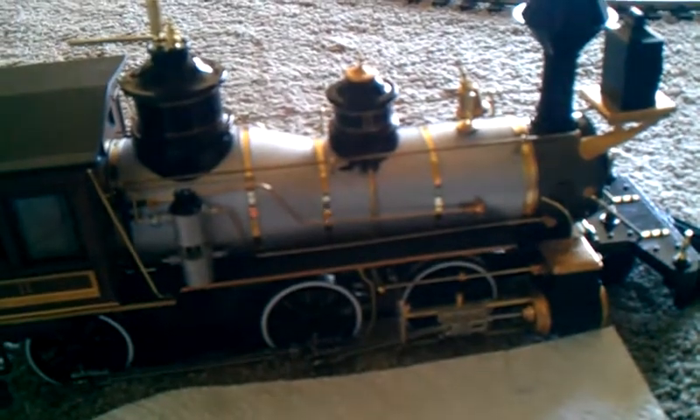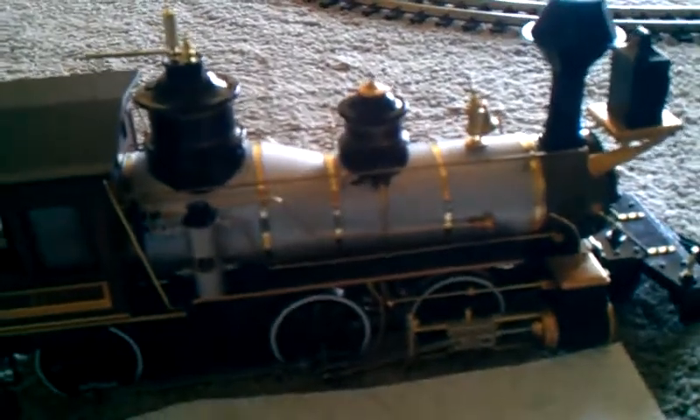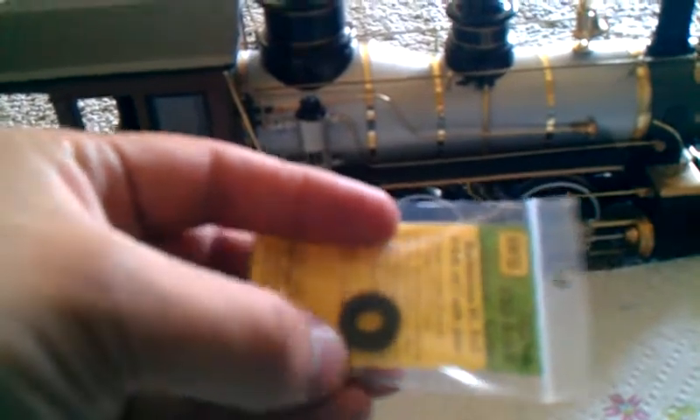This is an FN3 gear for a 440 or 260 axle. I'm doing it on my girlfriend's engine because, even though the gear's in pretty good shape, the original OEM gears are not the best. You see the middle hole right here — this one you sort of have to cut open, which adds friction and makes it really hold very well onto the splines. Whereas the older ones that they come with, they're too smooth, the gears are too thin, and they come spinning right off.